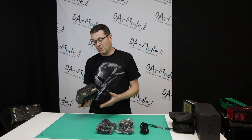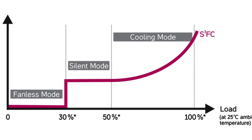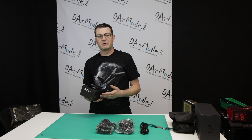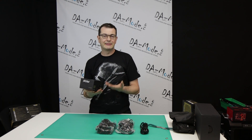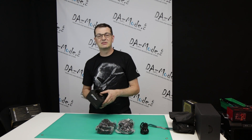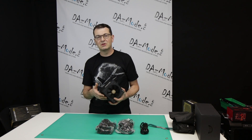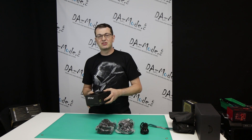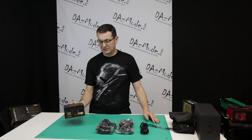So what this button does: the PSU will run with no fan up to 30% load. If for whatever reason you'd like to draw some air through the power supply even below 30%, you press the button and the fan starts spinning — that's your choice. If you idle a lot and don't want the fan spinning and bringing more dust into your computer, you switch it off. That's what it's for.